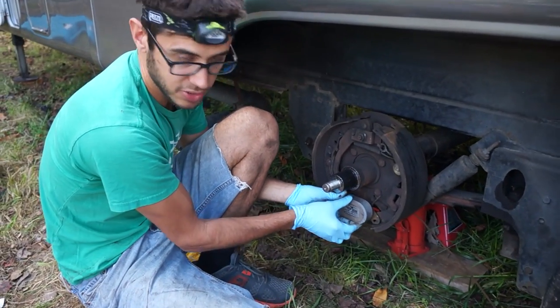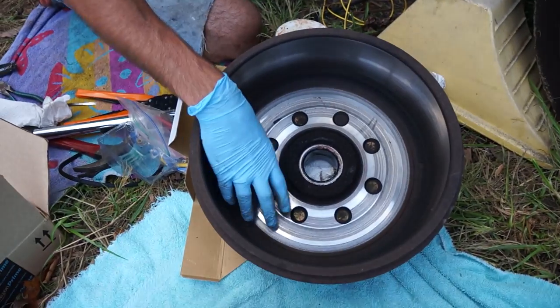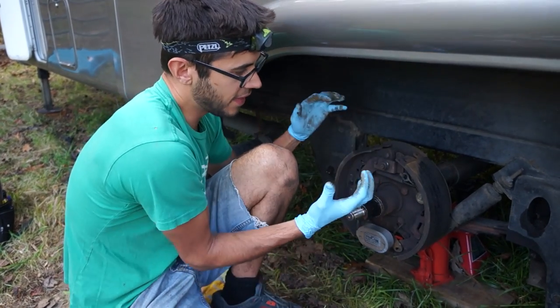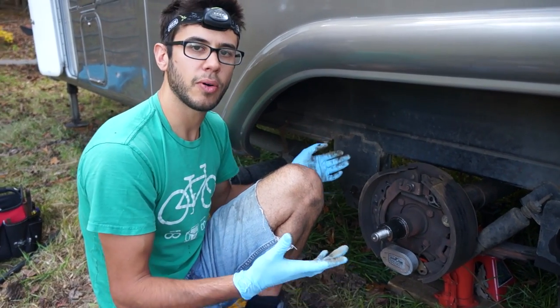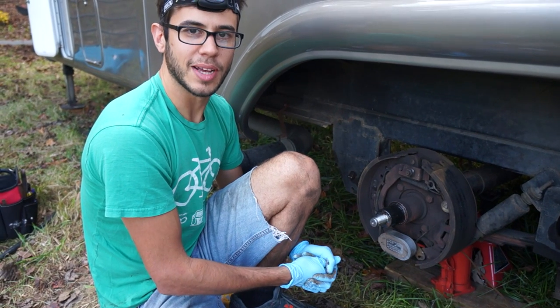So what's happening here is a very small amount of electricity is getting amplified by the movement of the trailer. The actual movement of the wheel drags the magnet along and creates a much much stronger force that presses out on the drum of the brake and slows the trailer down. That in essence is how electric trailer brakes work.